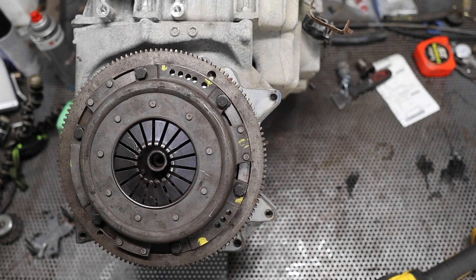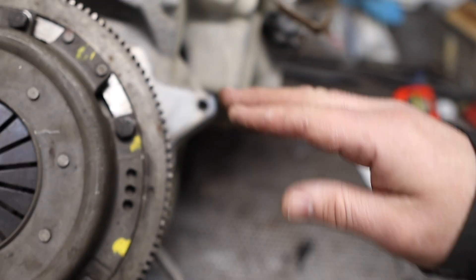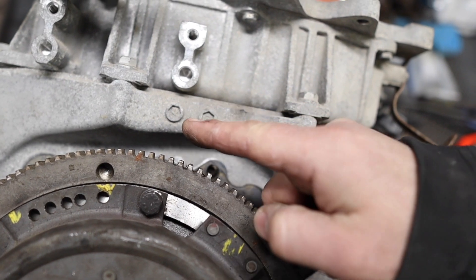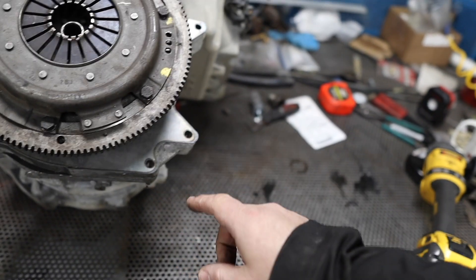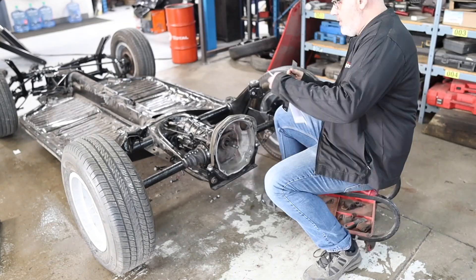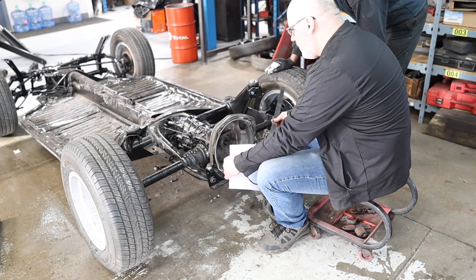All right, let's try Version 2. Take a look at our clutch. We're looking pretty good here — this is just the flywheel and clutch assembly sitting on here, not mating properly yet, just looking for clearance issues. I can definitely remove a good half inch of this ring gear since I don't need a starter motor anymore, so we can thin that down. So far so good. That diagram I downloaded of the bolt pattern just doesn't seem to be right.